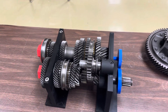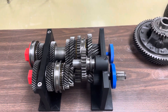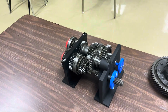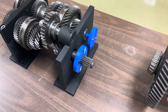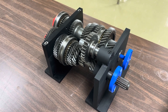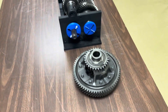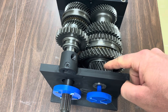When you strip it down, the five-speed manual transaxle is pretty simple — arguably more simple than the traditional way. What makes this manual transmission a transaxle is that it does have a differential gear inside the transmission, and this is there for front-wheel drive vehicles because of the space requirements that are just not available in a front-wheel drive. The differential needs to be inside the transmission to accommodate those axles in a transverse mount. This differential sits on what is the pinion gear here for the differential, which is the output of the transmission.